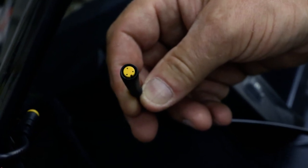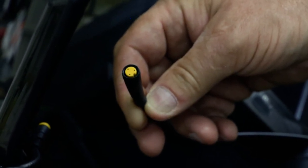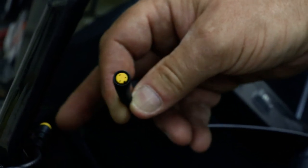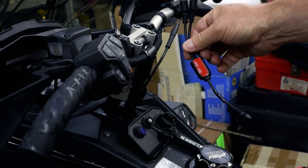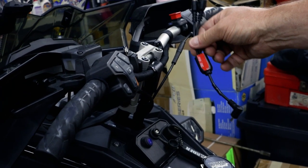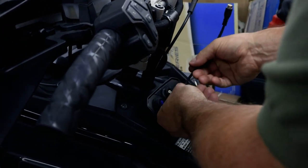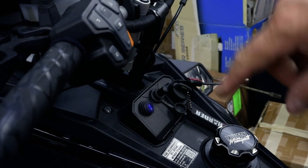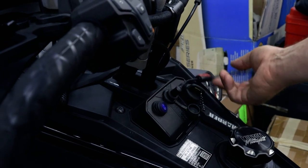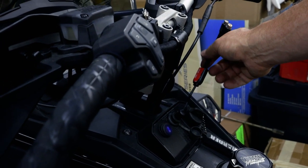You'll notice the connector coming from the power RCA jack on the snowmobile is indexed — there's a slot and three pins. You need to install that so everything lines up and it pops right together; that's the waterproof connector that keeps water out. In your kit you'll also get an RCA splitter so you can have power going to the trail courtesy light and power going to your heated shield cord. We're going to install this so it's out of the way of the handlebars, not rubbing on things. The back has 3M adhesive so you can secure it to an area of the sled to keep it from bouncing around.